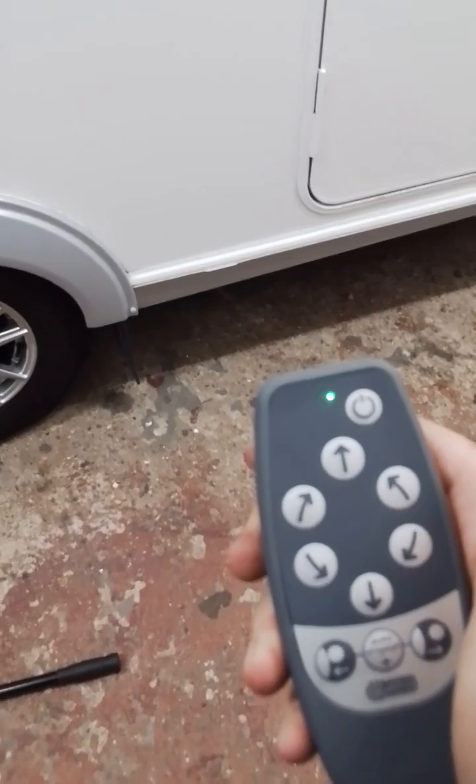When you're done using the mover, turn the handset off by two presses of the button, apply the handbrake, turn off the isolation switch, and then disengage the mover by doing the reverse of engaging it. If you have any other questions about any of your appliances, please refer to the book pack as there should be more information in there. Thank you.